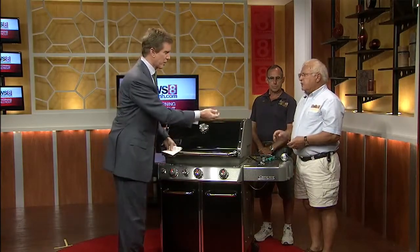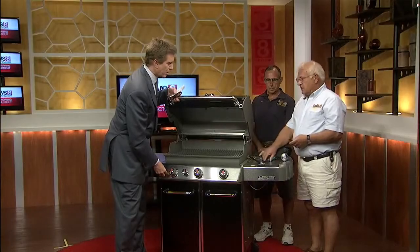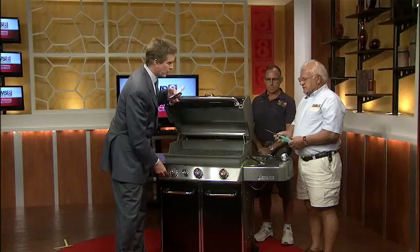No, you want to resolve the problem. The homeowner can usually repair these themselves. You can buy a kit depending on the model of your grill, and it will give you a new spark generator and a new button assembly. That should fix the problem. But in the meantime, so you can cook your meal, have a lighter handy to get it started.